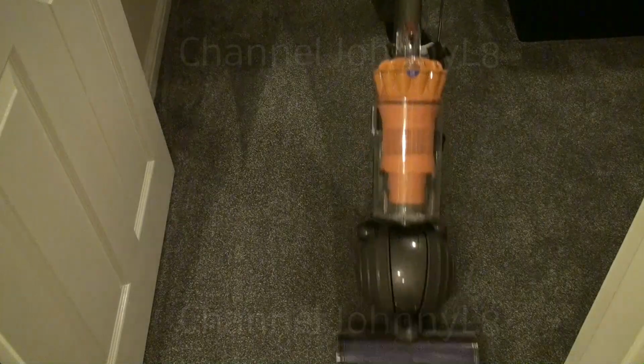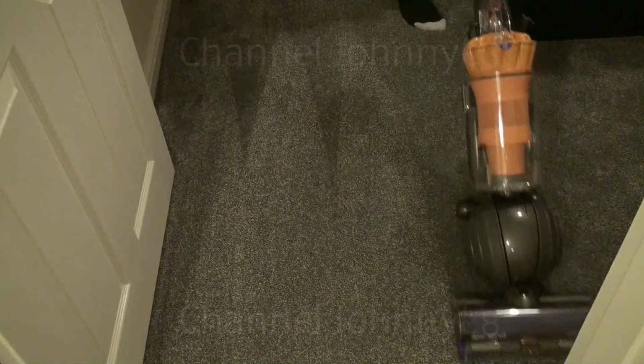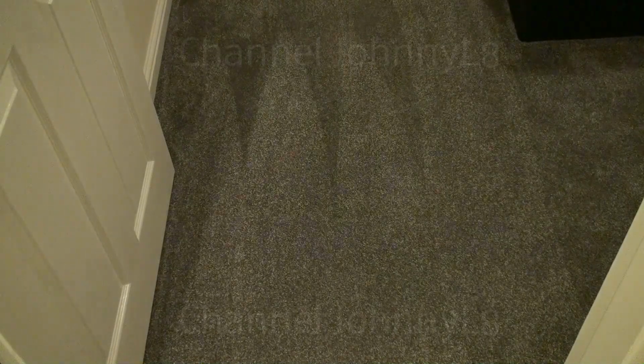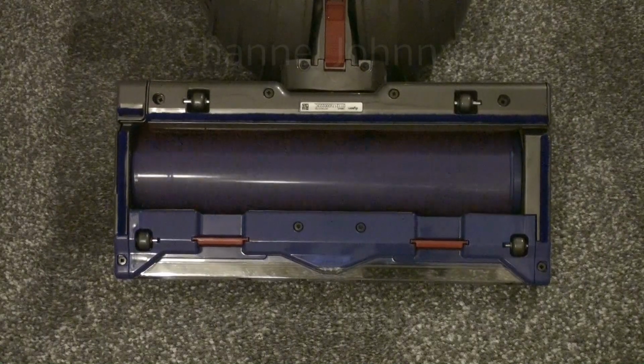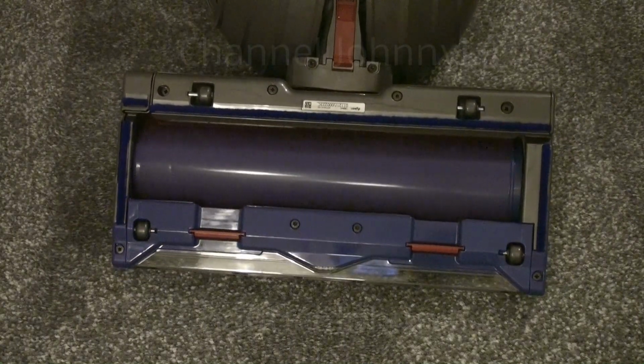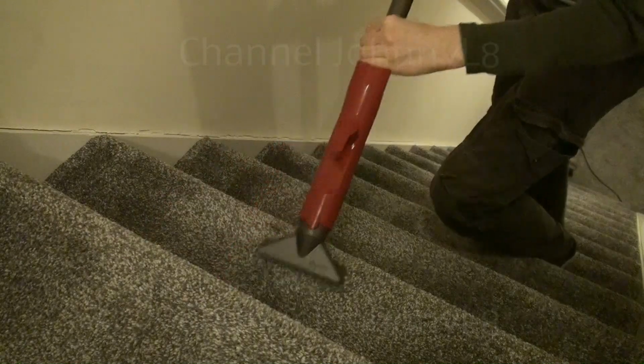The only negatives are the right edge unswept path is too large for carpets, as is the front edge, and the hose shouldn't have been shortened. It also has a funky smell when you first use it, which I think is the filter material, but that'll probably wash away with time. I do think they should have used kinetic technology in this and had a self-cleaning shroud. That stuff not being in it is a retrograde in available technology in my opinion.